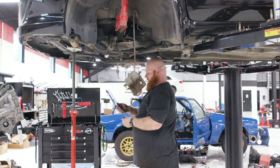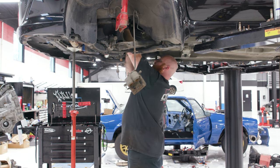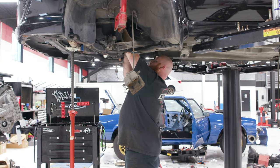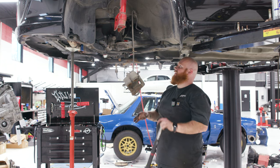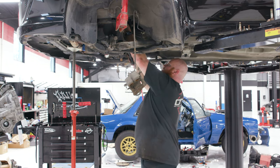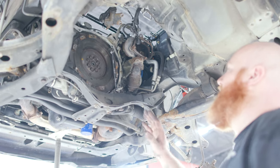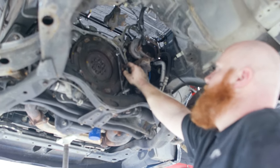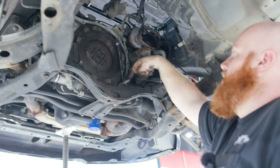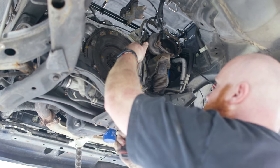Check this out. I'm going to take this wrench and put in one of the pressure plate bolts, and I'm going to put the wrench on the stud on the bottom of the block here, and it's gonna fixture the flywheel so that it doesn't move when I tighten it. I need an extension here, hang on. Okay, so if you're torquing down your flywheel, which on a Subaru is 55 foot-pounds on all 8 of these bolts, if you just take a pressure plate bolt and put it into one of the bolt holes and then put this wrench on the dowel, you can actually use it to hold the crankshaft in place so it doesn't spin.